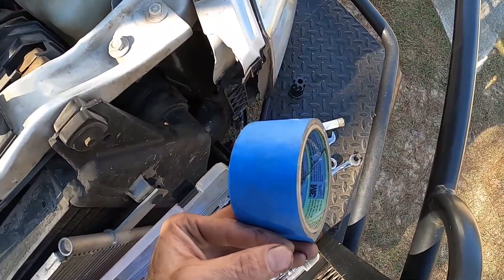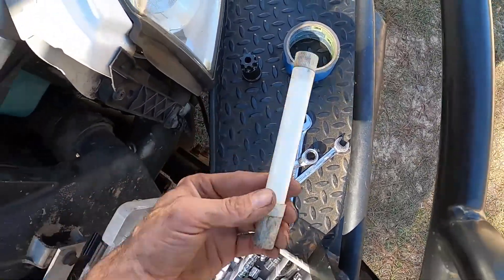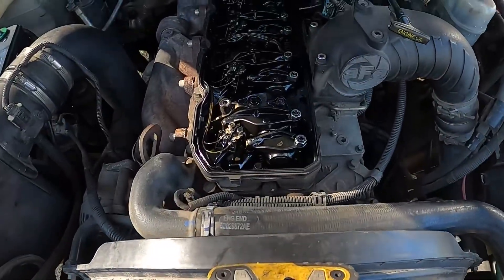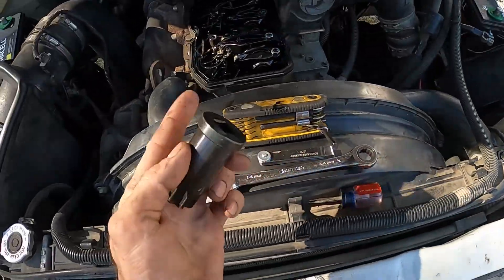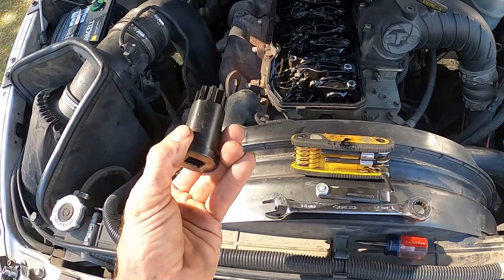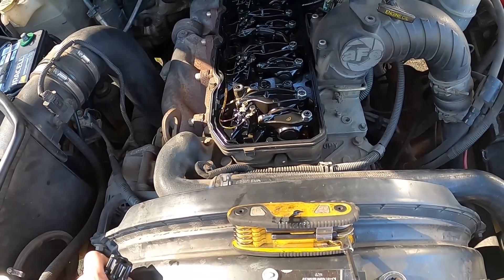What I'm going to do is use either a piece of blue tape in the shape of a triangle so you can lay it straight on that top dead center mark line, or a white pin. Another way is to use a barring tool, which goes into the transmission — it looks like a half-inch drive and you turn it — and that's usually when you've got a buddy underneath the truck.